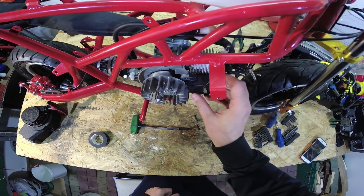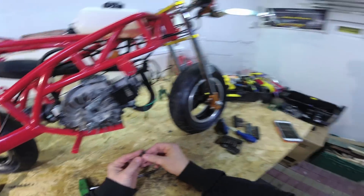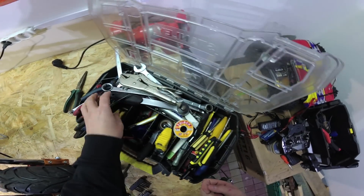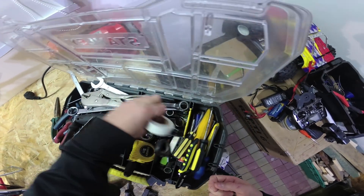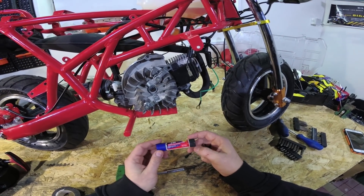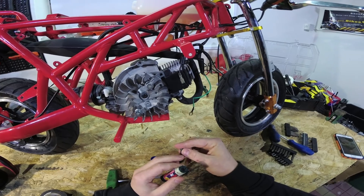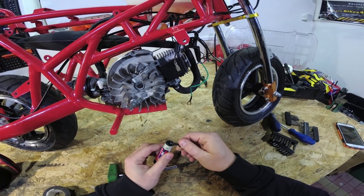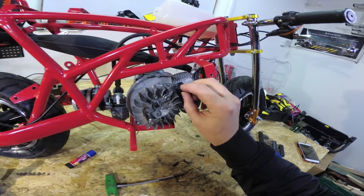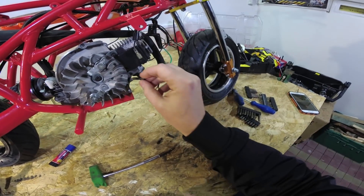When you cover the magnets, turn the magnets in this direction where the coil comes - then simply place the coil. The coil will stick to the magnets. Now just install and tighten the bolts. Before you install the bolts I do highly recommend that you use a thread locker. Because of the high shaking and vibrations of the engine, the bolts like to loosen themselves. So it's a good idea to place thread lock on the thread before you install them.